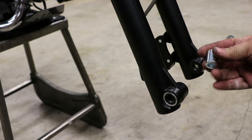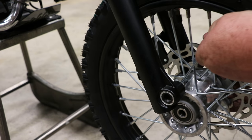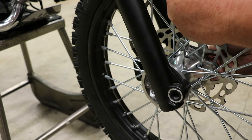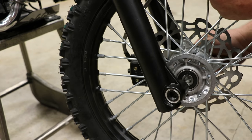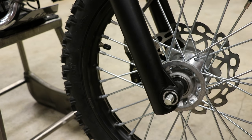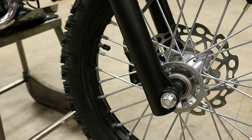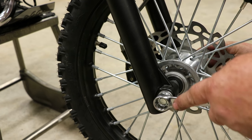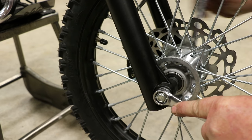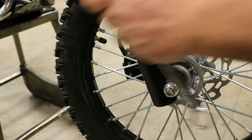We're going to install the front wheel with the long spacer on the disc side. Insert the wheel, sliding the disc up between the brake pads. Install the spacer and push the axle through, then install the shorter spacer on the opposite side and install the lock nut — starting it by hand to avoid cross threading. We do not recommend Loctite on this because it can cause thread stripping when it's time to change a tube or tire. Just bring it in snug; it is a lock nut and it will not come loose. As with any dirt bike, you'll want to check your nuts and bolts every ride.